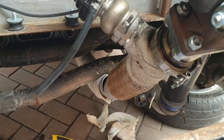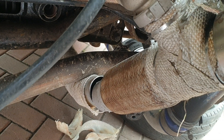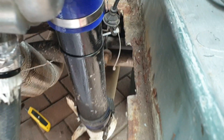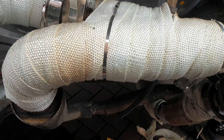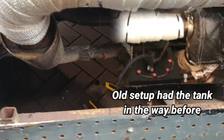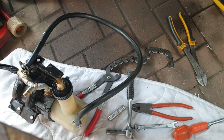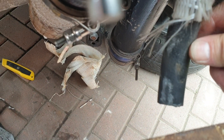So the next step of making it better — I've chopped the exhaust to the turbocharger there so I can spin the wastegate up to there. It was down this side, so with it up there it's out of the way of road debris, which is the other thing I wanted. And I've now got lots of room for activities here. That will now fit into this space up to about there.